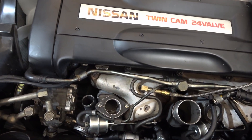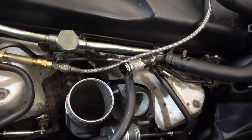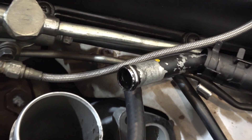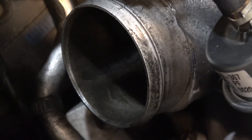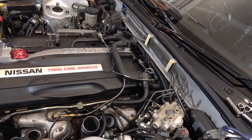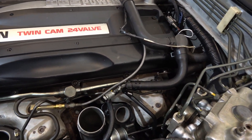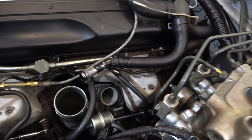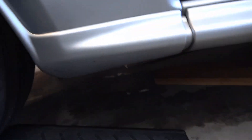All right, so this took me about 20 minutes to get to this point. We've got some oil blowby issues still - you can see oil in there and signs of it after I've cleaned all that out. But we've got a Nismo oil separator coming so we'll get that installed into the rear turbo and have it drain properly. At this point I'm going to go ahead and get underneath and take off the downpipe.